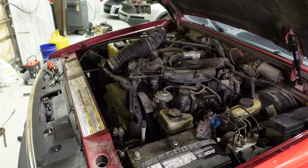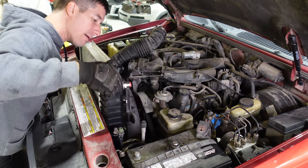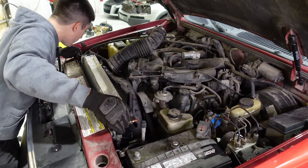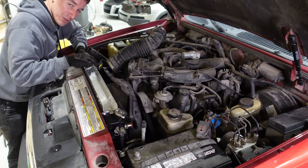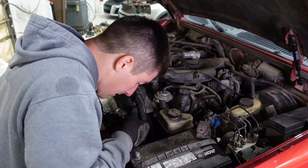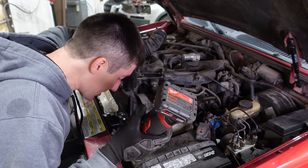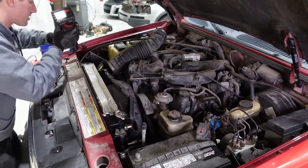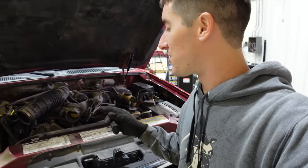Unless you like taking radiators out twice — it's up to you completely. A little wiggle, a little more wiggle. Fan shroud's catching me. There's one side, and there's the other side. The clip nuts that hold the radiator in both fell down on my install here, making this a little difficult to put back together, but we're going to get it. You might have to do a little finagling with needle nose to really make this happen. Now that the tins that hold the radiator to the body are in there, I can go ahead and run them down. Seems pretty solid. A few minutes later, we have all new radiator hoses and the new radiator installed, everything put back in.